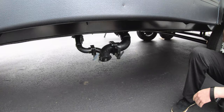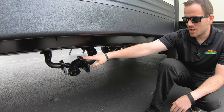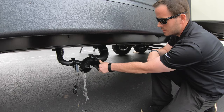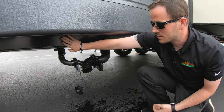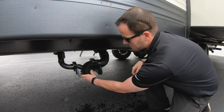Back here we have your dump station with two connections back here and one in the very back. Up here you have your black handle and gray handle — black is your toilet, gray is your bathroom sink and shower. When you dump, unscrew the cap, put your sewer hose in, and pull your black tank handle first. Wait till it's done, close it, then pull your gray. This prevents backwashing black water into the gray tank, keeps it sanitary, and helps flush out your hose with cleaner water.